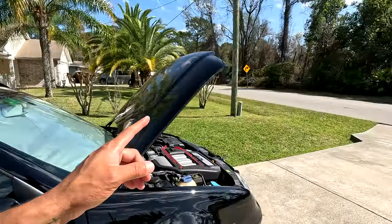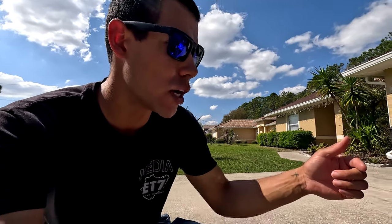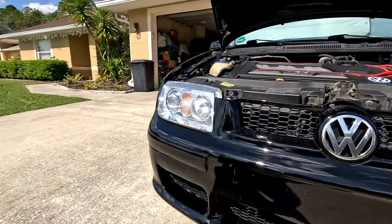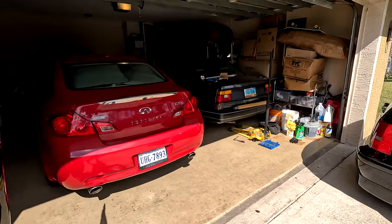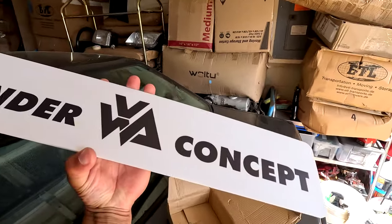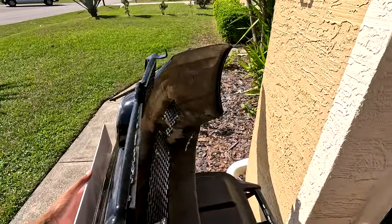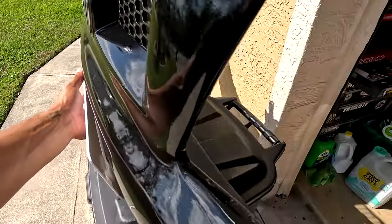What I want to do today is the front bumper - I have the Zender plate for the front as well, but I don't want to drill any holes in this bumper. I've been just taping it on for shows and taking it back off. I'm going to pull the bumper off, epoxy the magnets - six total, doing two then four then six on the back side of the plate. So you just pop it on and take it back off. The bumper is back off the car. The plan is to do the magnets on the plate side first, hold it exactly where I want it, then put the magnets on the back side.